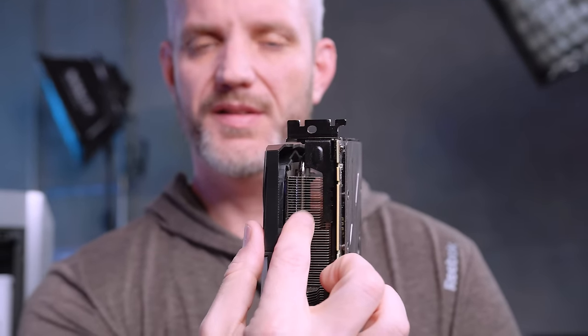That's acceptable and it will work with any card on the market. Any card that needs support — build it up so it touches the cooler and pushes it back up so it can't sag, because you see how it's leveraging there. There's a void that has to be filled, and if you can fill that void so it pushes up and the weight brings it to level, you're good to go. This might seem like one of the stupidest videos I've ever done — it should never have been necessary — but we've looked at so many builds in our react series with cards sagging all over the place. Just a couple of these things can save you from that. Thanks for watching. Share this video with someone that's got terrible card sag — friends don't let friends card sag. We'll see you in the next one.